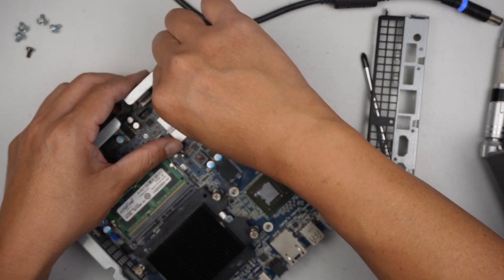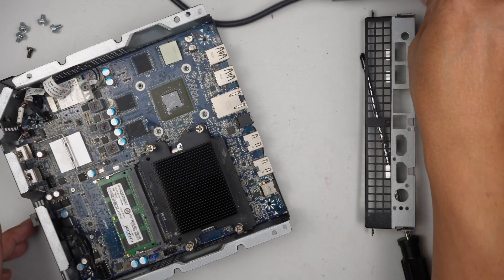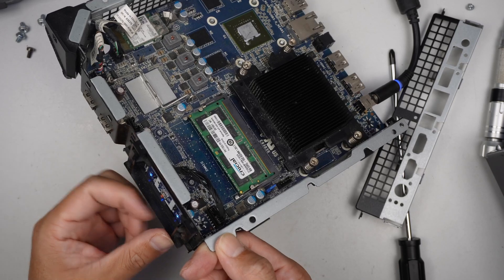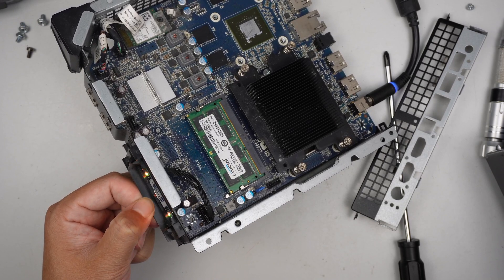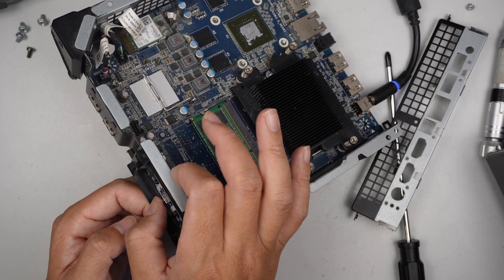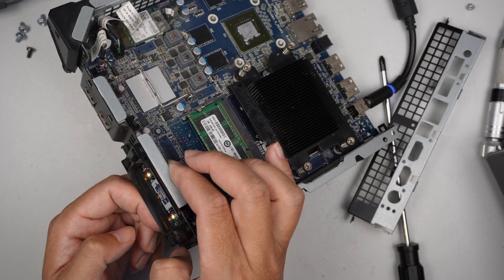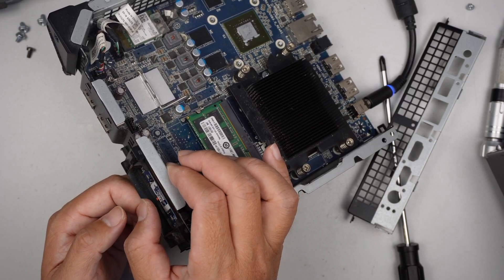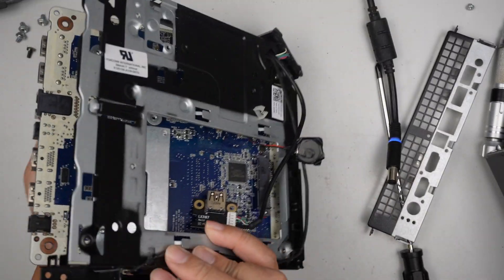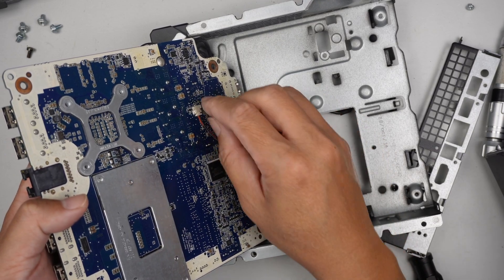Let's reconnect some of the cables back in. We are still getting the 5 amber lights. Let's try again. So definitely it's not the CMOS — doesn't seem like the problem actually fixed it. The CMOS is all the way in the back of the computer. On the other side I have reattached a brand new CMOS battery and I am still getting the 5 flashing amber lights.